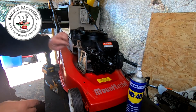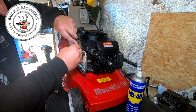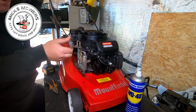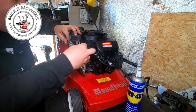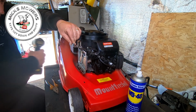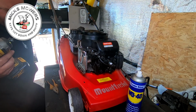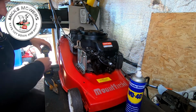I'm now going to hook up my choke cord, which is that one, and then we'll turn that round. I then want to set my machine to choke on the lever, all the way up, and then pull this arm back, so that's actually in the choke position. So that's full choke, off a choke on the arm, that comes off, back on choke, yeah, that's choking lovely.